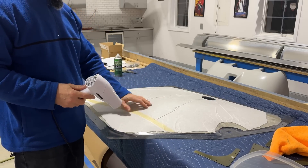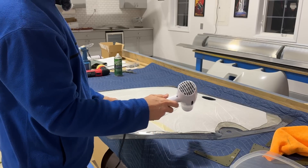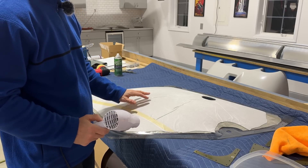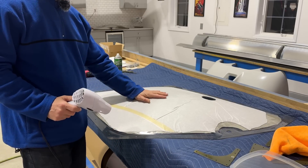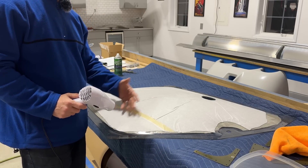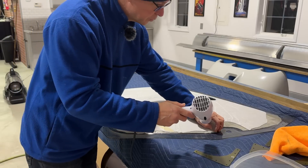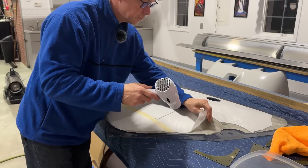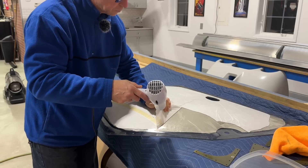This clip has no audio because I realized as I was editing this that the little battery in the DJI cordless mic that goes into the iPhone was dead. So what I was explaining here is that I've read so many times on the forums where people have issues taking this tape off of the window and it leaves a residue behind. This is not rocket science, guys — heat it up with a hair dryer and it will peel right off and leave zero residue left on your window. Don't use a heat gun because a heat gun is too hot and you could damage your window. I heat it up as I go and look how nice it pulls off — it leaves zero residue behind.